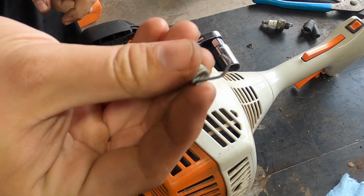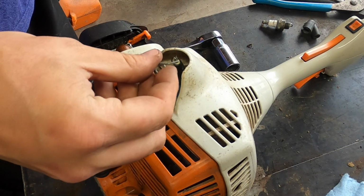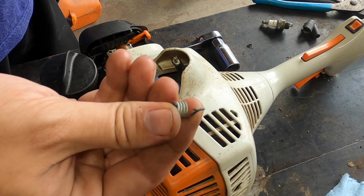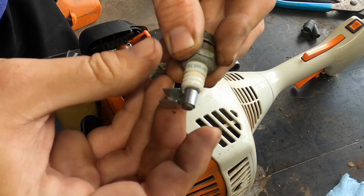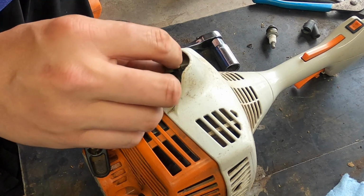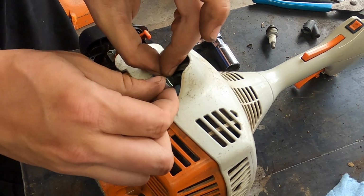The real one should really be this, and if you buy a replacement, it is this. All you do is shove it through the loom of the wire, and it touches the center, makes a connection, and then you put this on the end of your plug. I suppose the question is, does that fit? Okay, good. I was 99% sure it would fit, but that would be the luck, right? You get it all done, and next thing you know, it doesn't even fit.